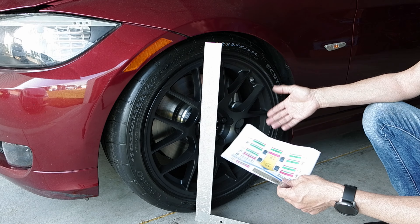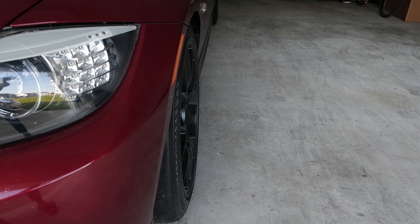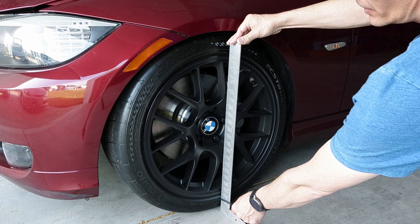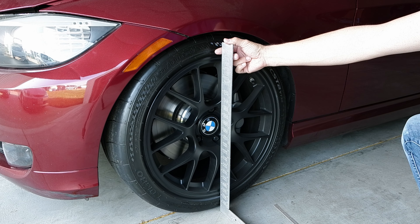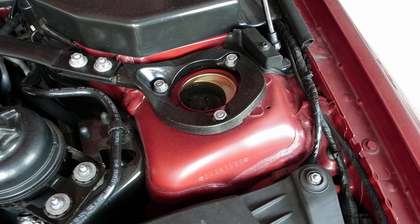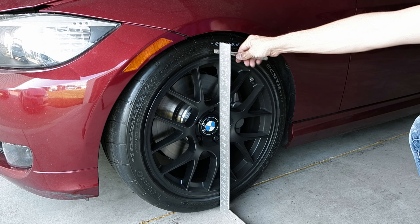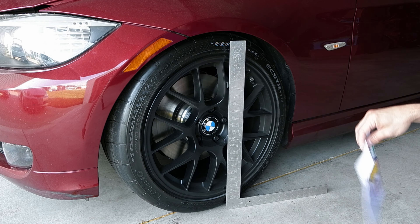I finally have something to show — the alignment is done. Here's the visual representation of this negative camber. I have my favorite measuring tool, this angle which sits flat against the floor. I touch the bottom of the tire against this angle, and that gap at the top represents the negative camber provided by those camber plates and the M3 lower control arms. I have about 30 millimeters of a gap, so I was calculating the camber to be at about minus 2.7 degrees.